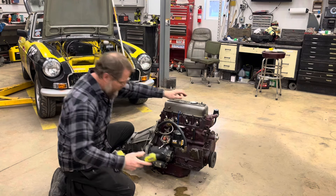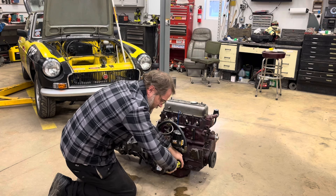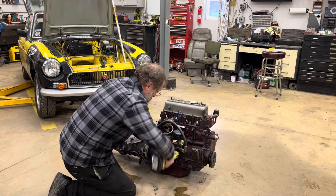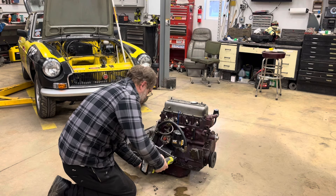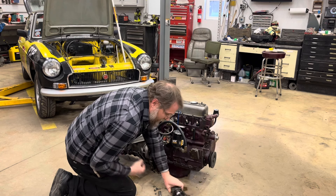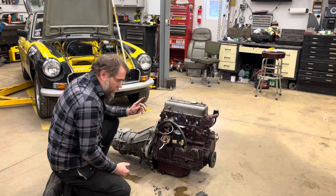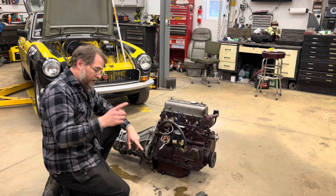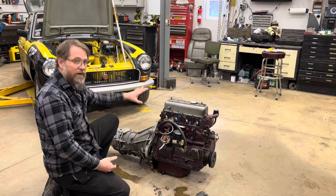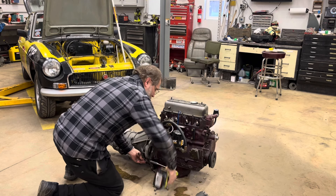For the starter, you need an extension to get back in here to reach that bottom bolt, and then you can get it started. I did have a high-torque starter on this before and I would have liked to keep it, but the Bendix had come apart on it just as I pulled the engine out. I didn't want to spend the money on another one, and it turned out I needed the extra weight of the stock starter up on the right front corner to help balance the car anyway, so I ended up leaving the stock starter on it.